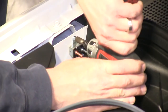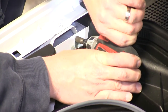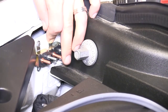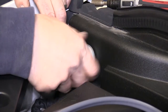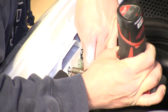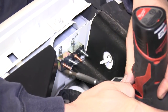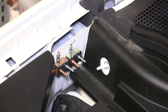Now we're ready to start mounting the breakers for our power wires. Note it may be necessary to remove the ground stud to make it easier to install these self-tapping screws. We'll mount a 40 amp breaker for the black wire coming from our 7-Pole Connector, and a 20 amp breaker for the power going to the brake controller. We'll use the self-tapping screws provided with our install kit to secure the breakers to the passenger side fender well.